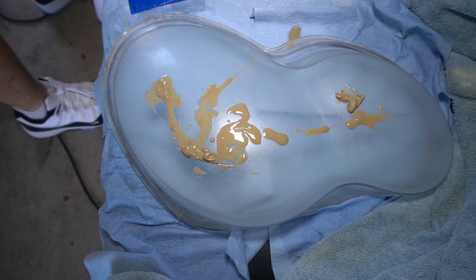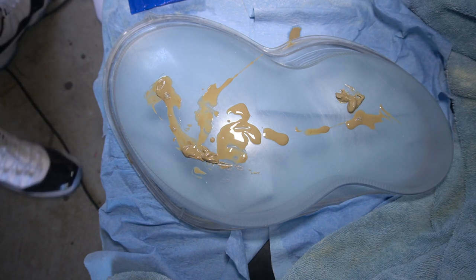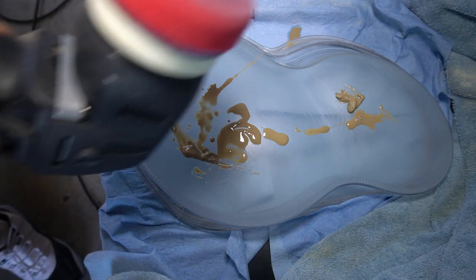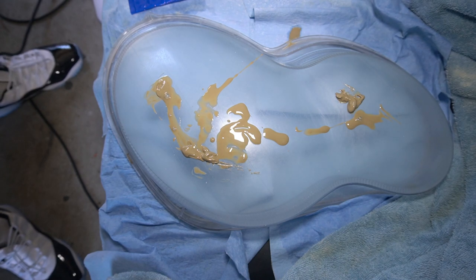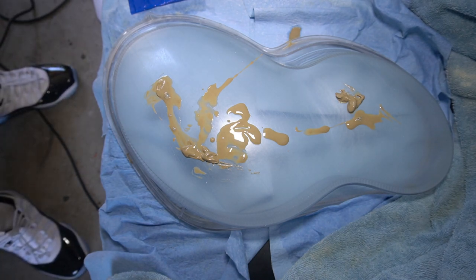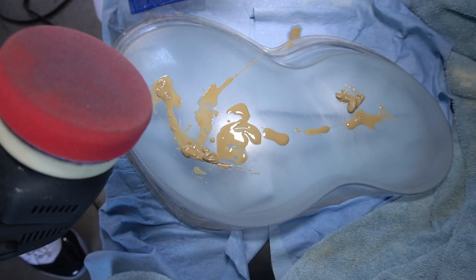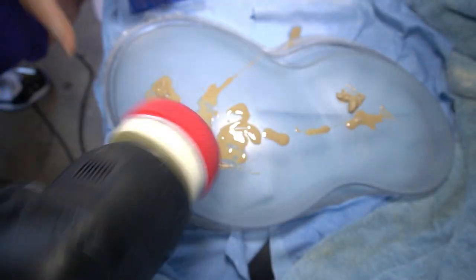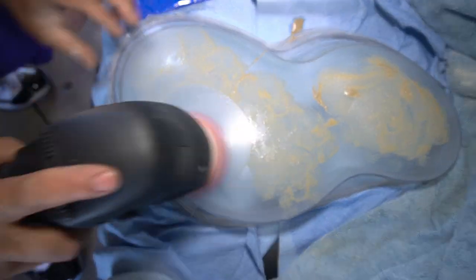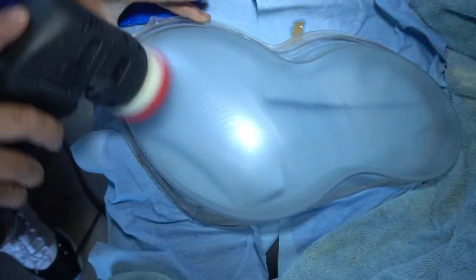and it's going to give you that nice finish. Now, they also supply you a foam finishing pad as well. You attach that to your polisher, or you can just do it by hand. And now you just polish the headlight. Do so until you are happy with the result. You will see it slowly come to life like it once was. So as you can see here, just from the polish alone, it's starting to look a little bit better already. Rather than having that really hazy, dull finish, it's already starting to look a little bit better.